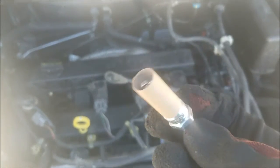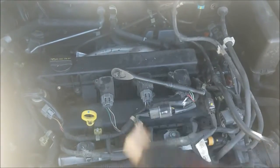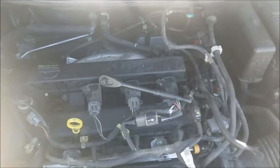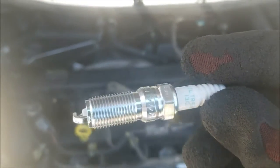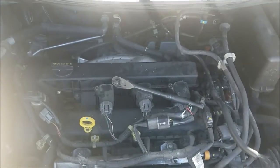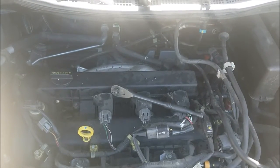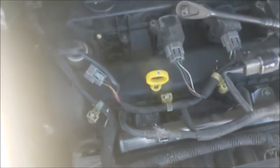The new spark plugs, when they come in, they're supposed to be already pre-gapped. That's what I'm using. I won't be gapping mine, I'll just go with what the factory sent it with and see how it goes. As gapping an iridium plug is always a challenge because the element is so easy to damage. So if you're pre-gapping them, pre-gap them and just put them in.